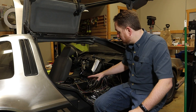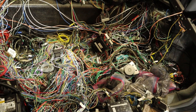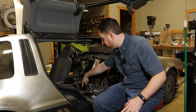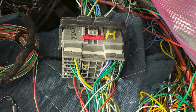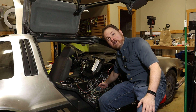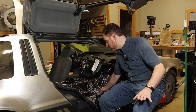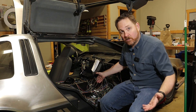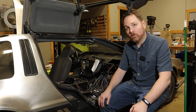One thing I want to point out before I get started: if you look in here, you see it's just a mess of wires - and it's mostly wire, not mostly modules. Yes, there are a number of modules here - you've got these four, plus the body control module (BCM) right down there which has like 100 wires going into it. But then you also have things like this harness connection that goes from one harness to another harness with dozens of wires plugged in, but it doesn't need to be there. So I'm literally just going to remove these entirely. A lot of what's over here is just wire - some of it literally wraps around and goes nowhere. This is going to cut down a ton of this spaghetti.